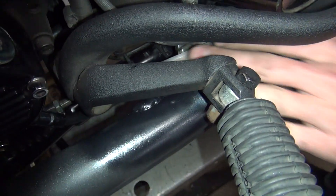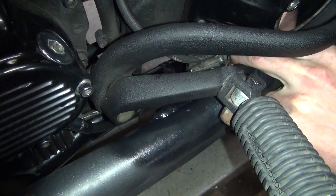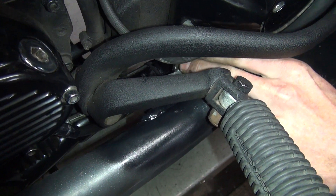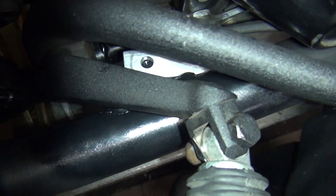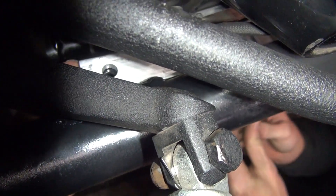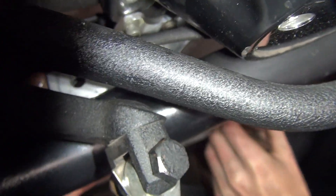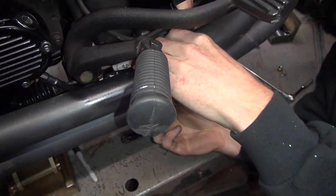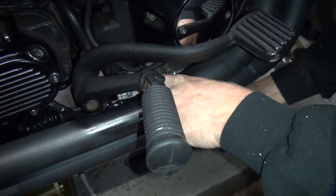Put the front hole in first and then we'll see how the other one goes. The bolt should come from the top going down — that's the preferred way of doing things. That way when the nut gets loose, the bolt still stays in there. See how close that lines up to the hole. It's not going to go exactly there. I think you've got the bracket in square — actually, I think the bracket's wrong. Pull the bracket back out, I think you've got it backwards.